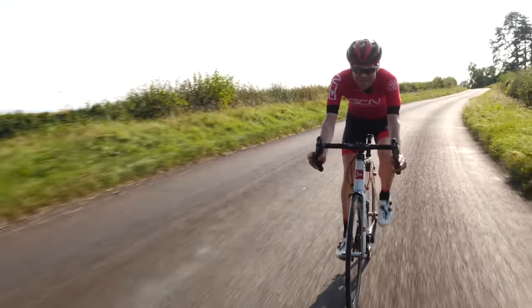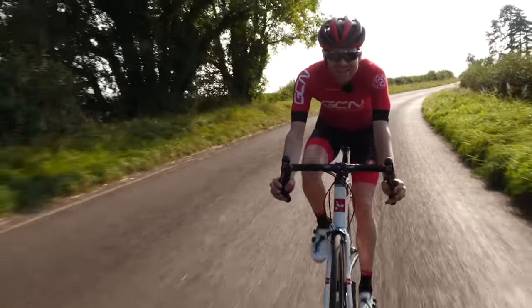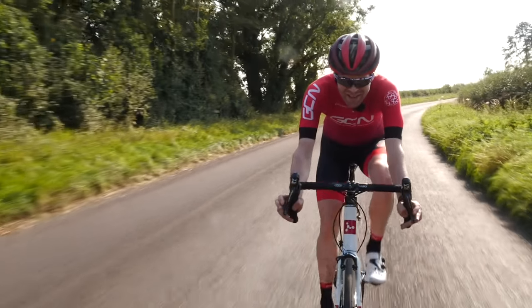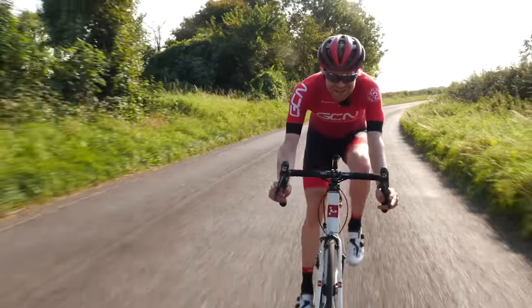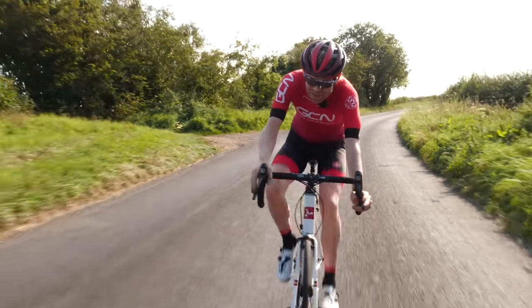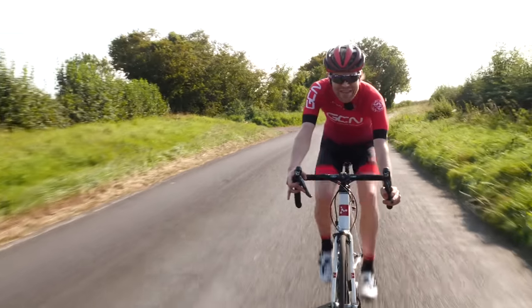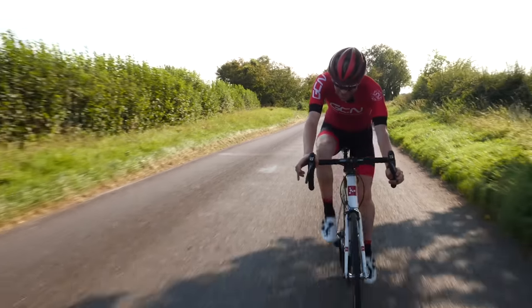As a comparison, the gear changing on the old Dura-Ace is still really crisp. It's like it just goes bang, bang. It's like loading a bolt action rifle, but the lever throw is noticeably longer. I mean, you can see that. That's how far it goes. It's got shorter on the new stuff.